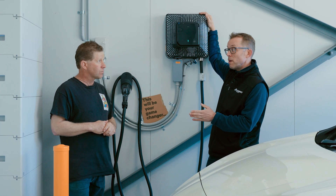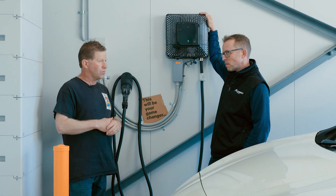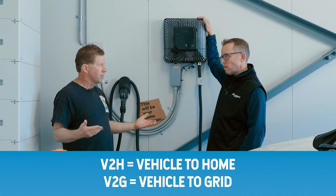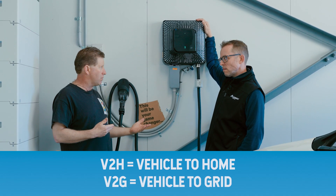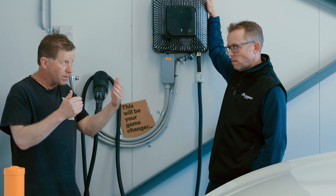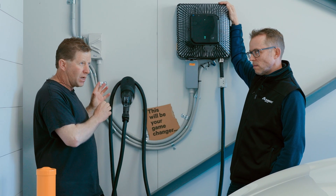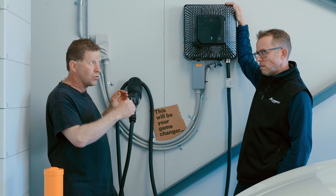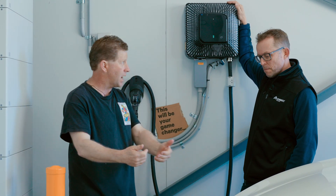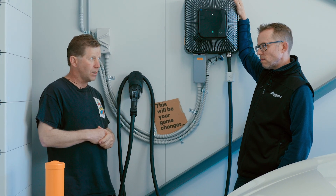It's really important for people to realize there is a minimum discharge from the car. This unit has the ability to do both V2H and V2G, and you can adjust settings with your phone. With V2G, it's not just putting power on the grid as most people think — it powers your house first and any extra goes back to the grid. V2H only draws from the car what the house has used, but you have to be drawing more than 1.2 kilowatts.